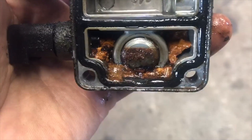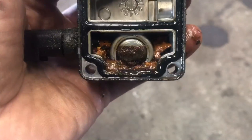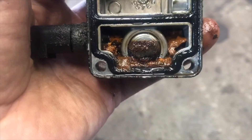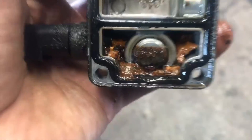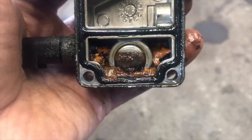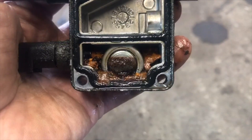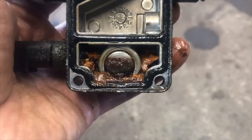As you can see, the whole bottom of this separator is filled with brown crud — it's a combination of sediment and water that turns into a mud-like solution. The water-in-fuel sensor works with two terminals, and the water completes the connection turning the light on. Once this crud builds up in the bottom it trips that light, and sometimes you can clean it but I've had much better luck just replacing the housing.